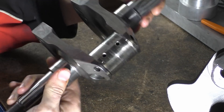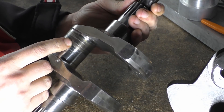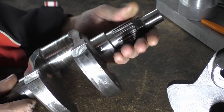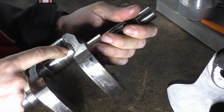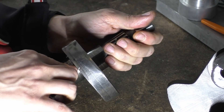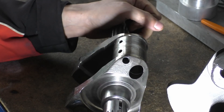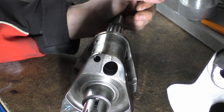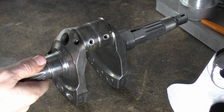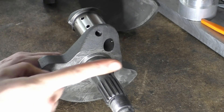To finish off, we'll look at the forged crank. This one we've looked at before, and it has the same kind of cracking — you can see that crack that runs down there. It starts there and cracks all the way around and then stops. Again we've got that fillet — that radius in there — that started to break, and this thing's in the bin as well. Ducati, you're going to have to pull your finger out because we really don't want to be seeing failures like this. I hope that makes sense — I'll see you in a bit.